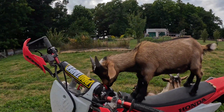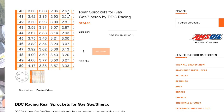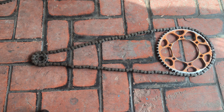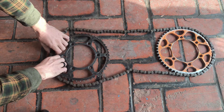There are different size front sprockets and different size rear sprockets — which one do you need? To make it short, simple, and easy to understand: the bigger the difference between the front and rear sprockets, the more torque you have, and torque equals acceleration, but you sacrifice top speed. The smaller the difference in size, the more top speed you have but you lose acceleration.